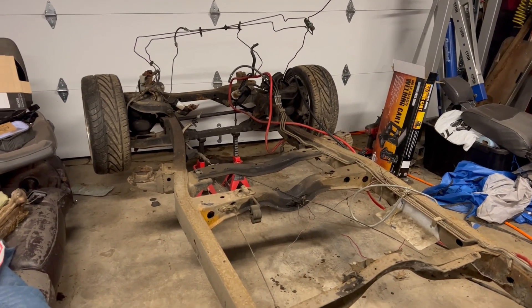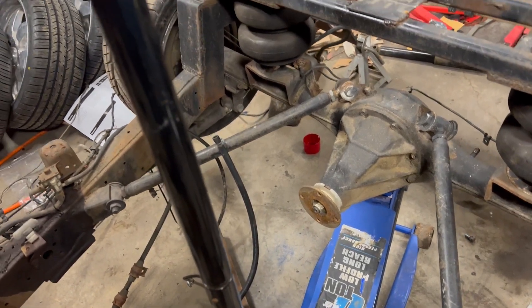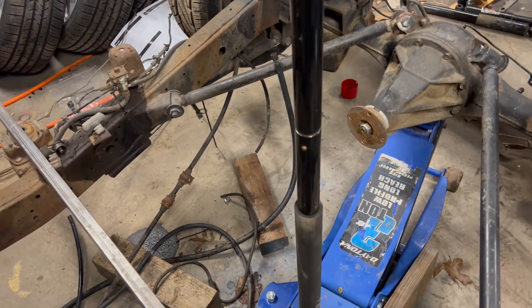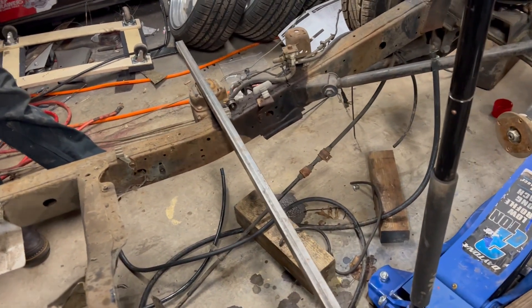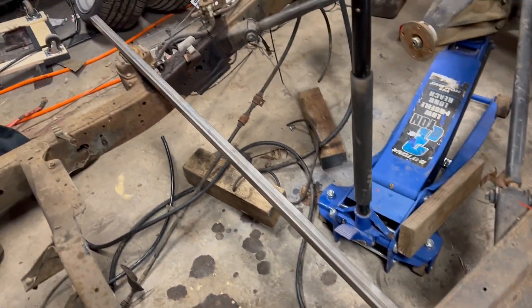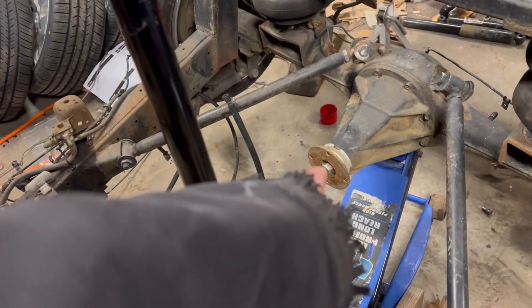As we're stripping the frame, we're looking at the axle which is going to come out. We're going to change the notch, the links, and everything. We have no way of knowing where the axle sits, but we know it connected before, so we're going off a reference point. We put a bar straight in the middle of the rear cab mounts - we know it's going to be here exactly when we put everything back together. We'll tape measure from the axle or driveline flange to the bar and write that down.